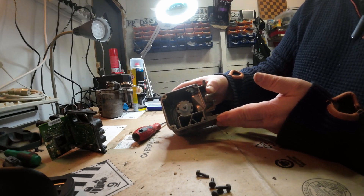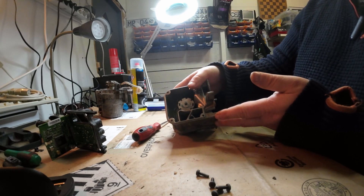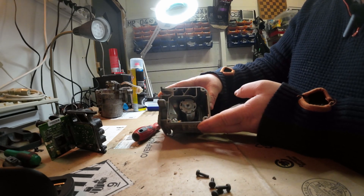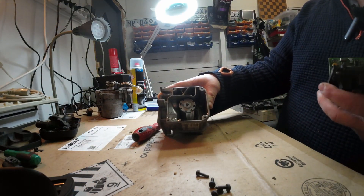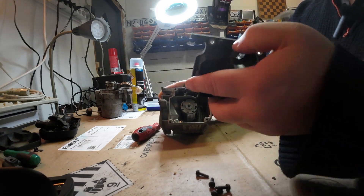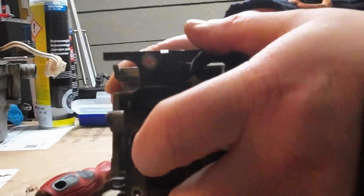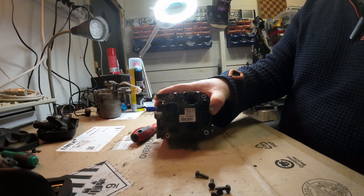This is the fan unit. Now you know how to at least check and refurbish it. To go further you'd have to use some force to pry off covers, and I can't guarantee you'll have a functioning unit when done, so we'll leave it at this. Be careful when you put this back because of the recesses in the PCB — if you put it back wrong you will destroy the unit. Make sure the gray rubber gasket is in its place before you reassemble. Just put it gently back together and then put the four screws back and you have a complete unit once again.